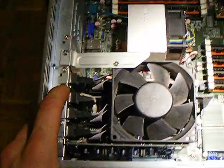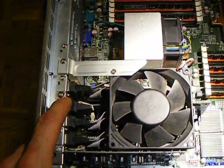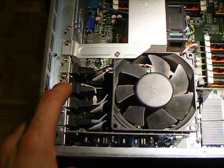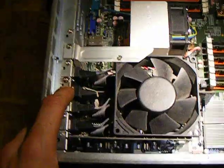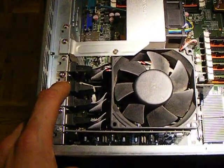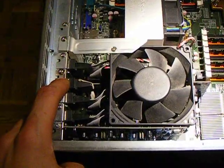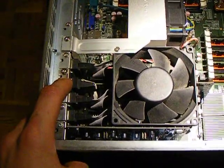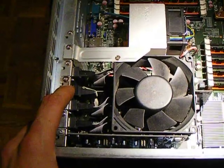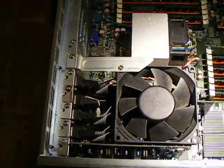The new card I just threw in — I don't even know if it's going to work yet, but I'm hoping it does. I took a PCIe x16 card, some wire cutters, and a file, and I dropped the card down to x4 PCIe 2.0. I don't know if it's going to work, but I hope it does because it's currently sitting in an x8 slot.